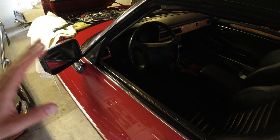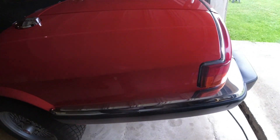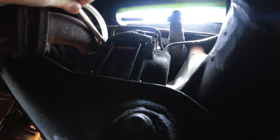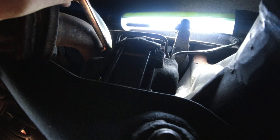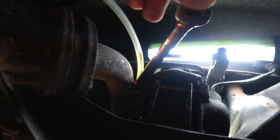Once that's all done, you can wait a little bit for the pump to cool down again. You're not going to use the pump for the front brakes, but I think it's a good idea. I have my lovely assistant wife here. She has the ignition on and I'm going to climb underneath. I'm under here at the rear brakes. I've got a hose on here going into a plastic bottle, so I'm going to open this bleed nipple now. No fluid so far — we wait a minute and do it all over again until nothing comes out except fluid. And as you can see, we got fluid coming out nicely now.